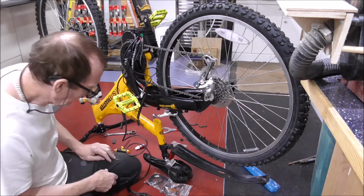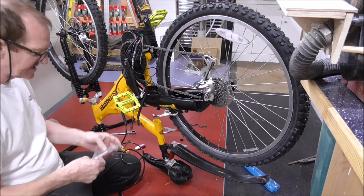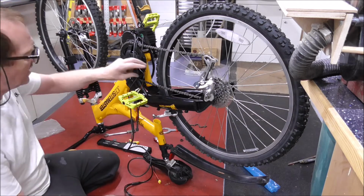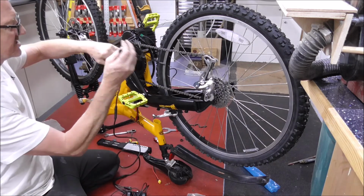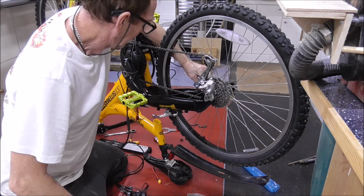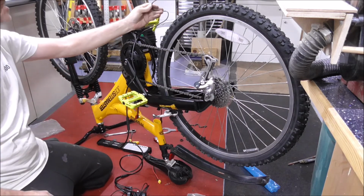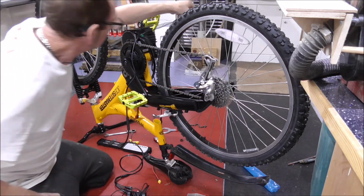Now, this, I've got a clue. What else is connected? They're connected. This is an extension power cable. So yes, they are power cables. There's your extension power cable. This is for lights. So that is for your speed sensor, because this goes on this side to the back wheel, somewhere around there. Then I've got this left. Now this is for the gear shift sensor, which I'm going to add. So that will go up it.